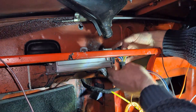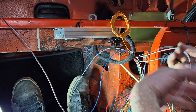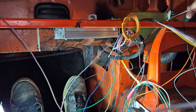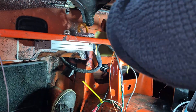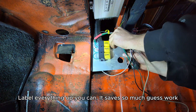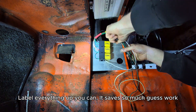For the ECU wiring, I tend to run that down the left-hand side of the car. That also means the wiring is away from any interference from big battery cables or high power cables, so you're not going to have any interference problems when it comes to sensors. Wherever you mount your relays should be somewhere between the ECU and the fuse box, so that both can take and give supply to the relays easily.